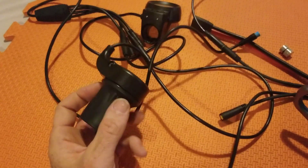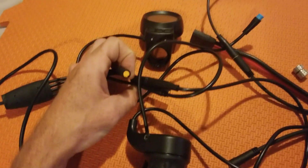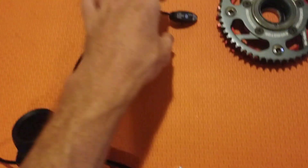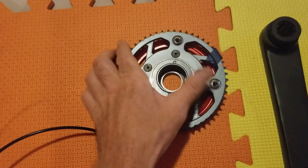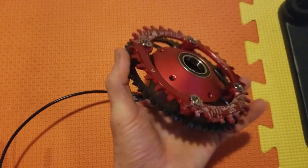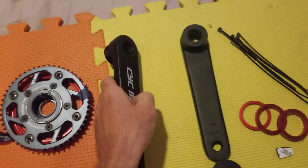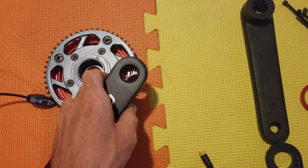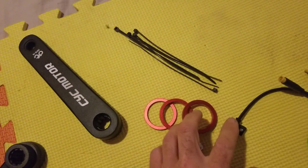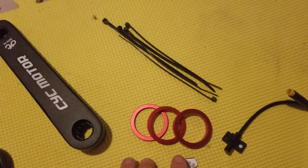This blue one here takes the main wiring harness. I've gone with the twist throttle option. This is the main wiring harness here and you've got ports here for the brakes and for the display unit. And this is the display unit here. This is the speed sensor. You get one of these wheels here, which is the freewheel and the reduction gear. I'm going with this one, which they call a 32 tooth to try to start with. You get two crank arms. This one screws into this piece here and this is the non drive side crank arm. They give you a bunch of spacers to help fit it on my 68mm bottom bracket. You can do it on up to an 80mm bottom bracket with this kit.